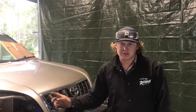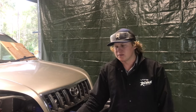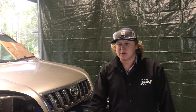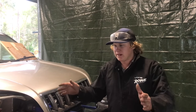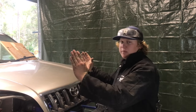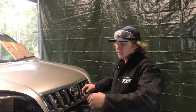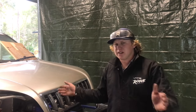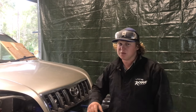I've started making my new chassis and radius arm brackets. And yeah, I'm trying to piece it all together now so that I can add some caster back in. So before, basically, I set it about 7 degrees. And the way the diff was sat back on the angle, because the arms are obviously under, the tie rod would foul on the arms pretty bad. So now that I'm bringing the arms on top, I can add as much caster as I want. And I've never run into clearance with that.